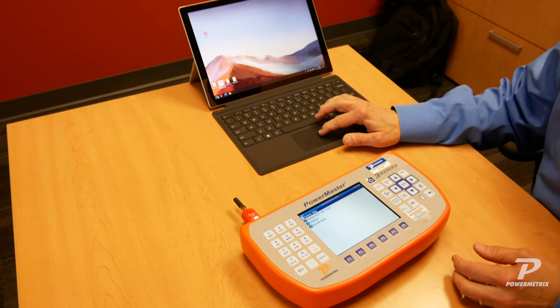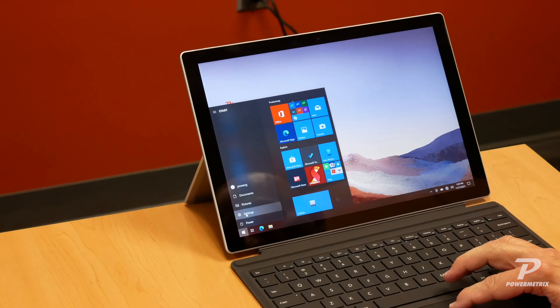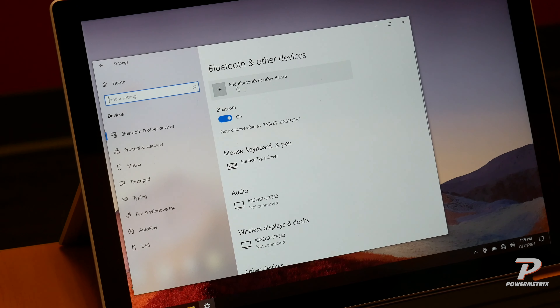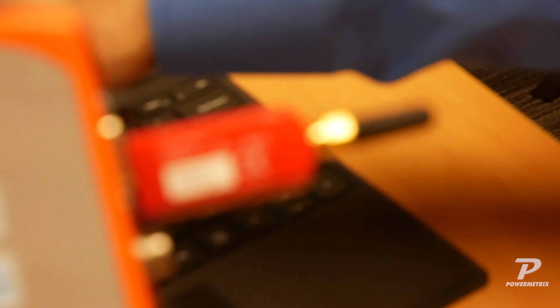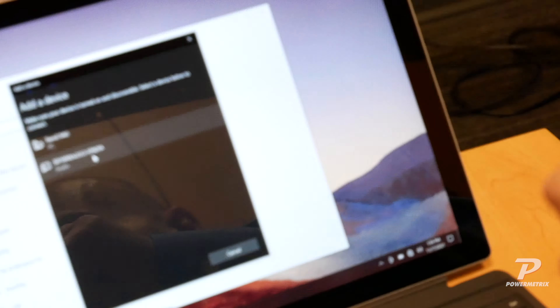At this point, we can go into our Bluetooth configuration under Settings. Once that comes up, we'll go to Devices and make sure that Bluetooth is turned on, as it is here. We're going to go to Add a Bluetooth device, and once we're there, we'll select Add a device under Bluetooth. The Bluetooth adapter has now appeared in the Add device menu. We can confirm it's the correct one because the last five digits of this number match the last five digits on the adapter. We'll select it and it's connecting.